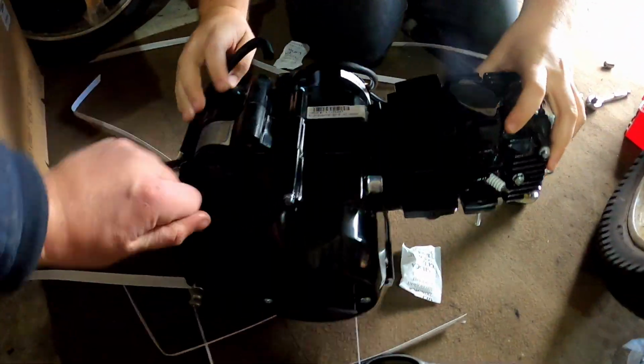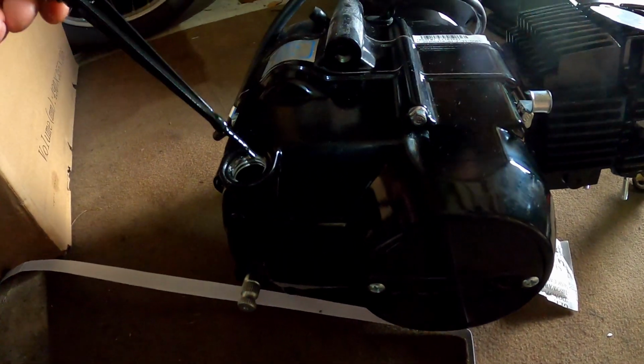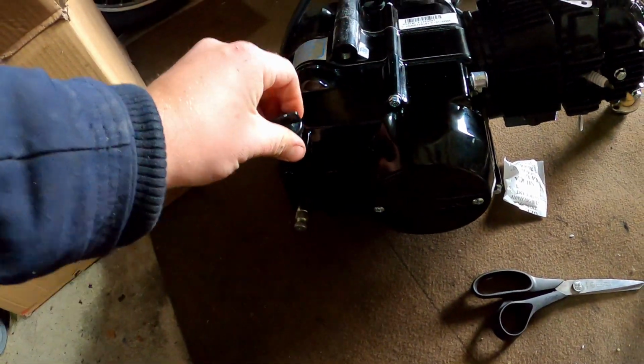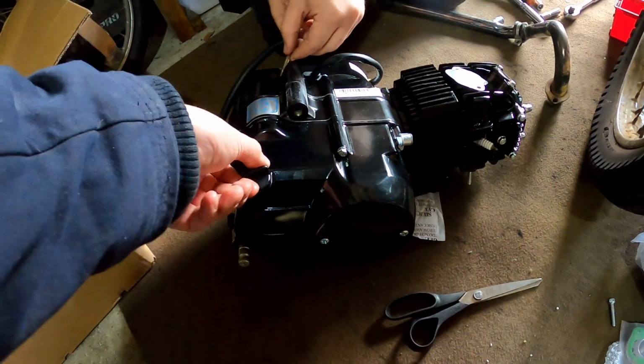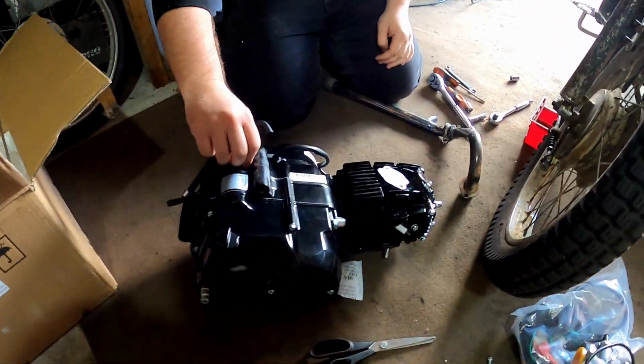You start it up, run it, and I'll show you the level. It's, well, it's everywhere because the motor's kind of been sideways, but let's check it. From the factory, the oil level is about 2/3 of the way up, but it's almost cooking oil. Don't use it. Run the motor for a minute or two and then drop it out, and just put any 10W-40 motorcycle oil in.